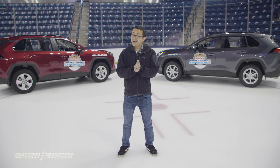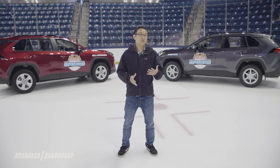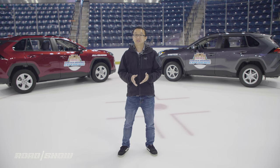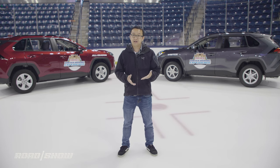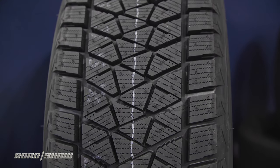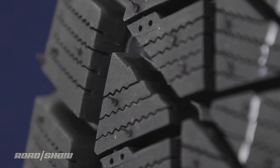So, what did we learn on the ice? All-wheel drive does a good job masking the deficiencies of all-season tires when accelerating in slick conditions, but it doesn't help with braking or turning. Those situations rely mostly on mechanical grip from the only thing connecting a car to the road — the tires. To get the most out of that when temps drop and the snow flies, the answer isn't all-seasons, but winter tires with specifically developed compounds and tread designs that ultimately make for safer winter commuting.